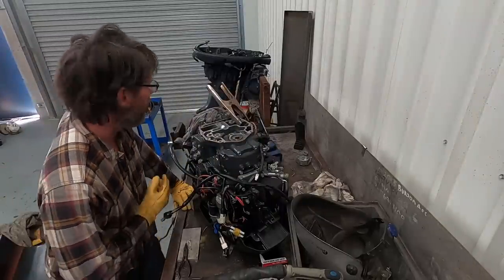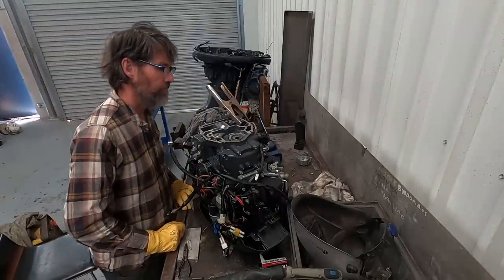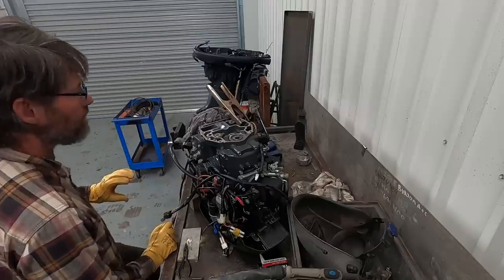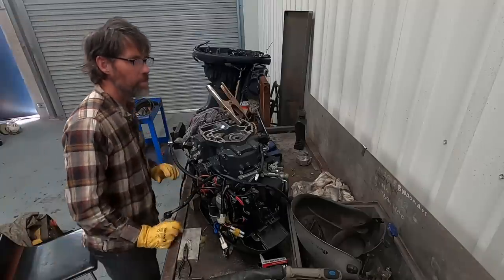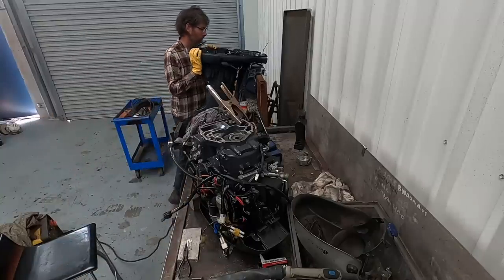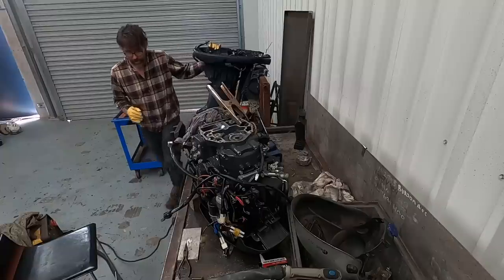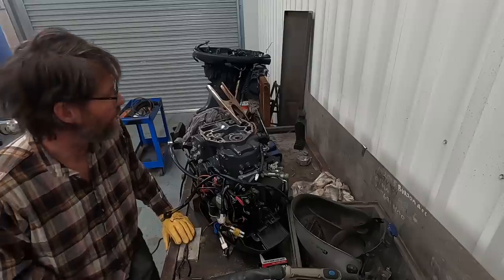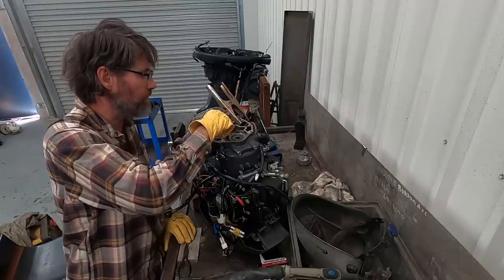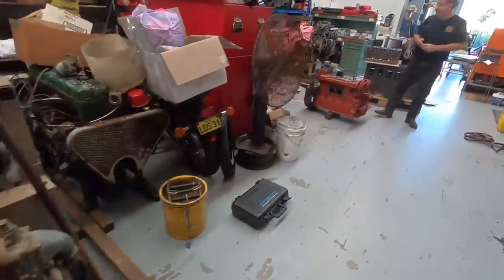May not be a problem, actually. It may even go into a cavity down there. So, it's almost dead centre. Yeah, I think the lumpy metal actually will not be in the way of anything. We just got to keep the gasket surface flat. Going to start doing some pressure testing on the repair now, but first, cylinder head going on. Fell on the floor, Stu.